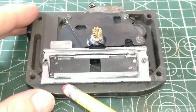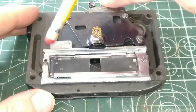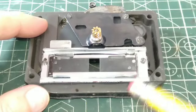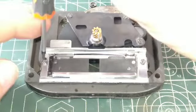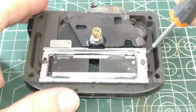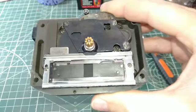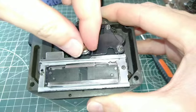Usually it's going to be even right along the silver part of the leaf springs with the turret. Everything's going to be lined up due to the screws — that's pretty much the alignment and you're generally good right there. If you have any image issues you can go back and adjust, but generally you're fine. I've added a little too much anti-seize and I need to clean up this area with some alcohol, but other than that I take my screwdriver and tighten the leaf spring screws — just a touch — on both sides. And pretty much we're done. Spin the shutter around and that's what we've got: a nice smooth action.